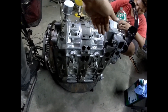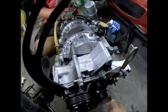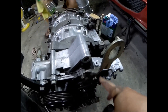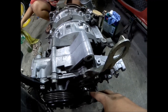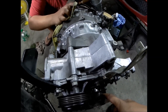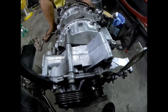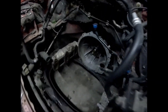Three aluminum parts means a three-rotor engine, and four aluminum parts means a four-rotor. This is the water pump pulley and the main drive pulley — you can't call it a crankshaft pulley since the shaft is not a crankshaft but an eccentric shaft, so you call it an eccentric shaft pulley or main pulley. This one drives the water pump and alternator, and this one is for the aircon compressor.